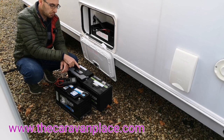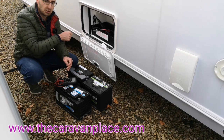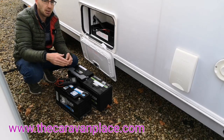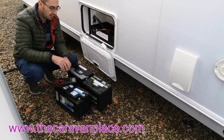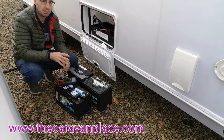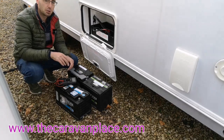When the battery gets down to below 12 volts, it's very difficult for the caravan charger — even when you're plugged into the mains electric — to really recover the battery. All you're ever going to do then is just prolong the death of the battery. So even through the summer I would advise removing the battery, having a good charger, giving it a good full charge up and then putting it back on.